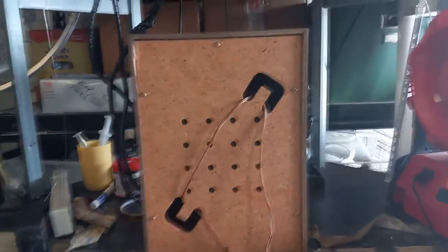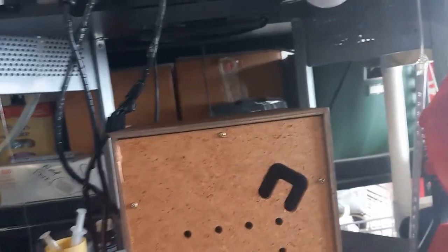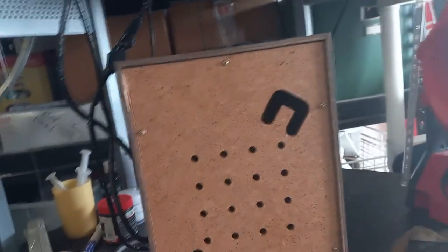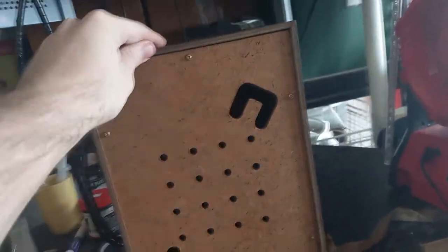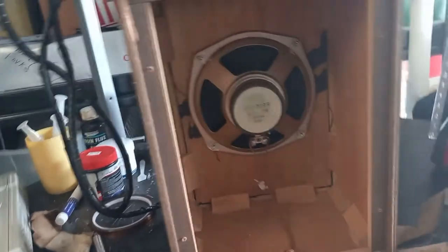We're going to open this and see what we're dealing with. It looks like there are seven screws and we can unscrew all these and this backing should lift off. From my experience some of these manufacturers also had glue lining the inside that would make it very difficult — near to impossible — to get these backings off. You can heat up the sides; I wouldn't pry anything. I've made the mistake of doing that myself and have broken a few of these little cabinets.